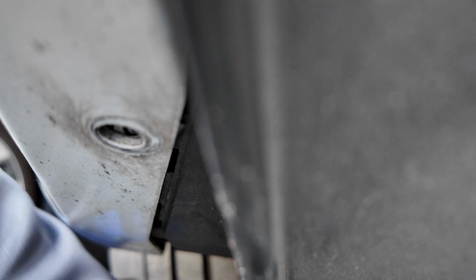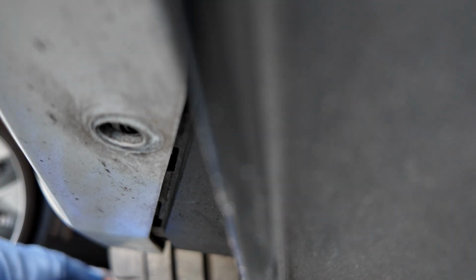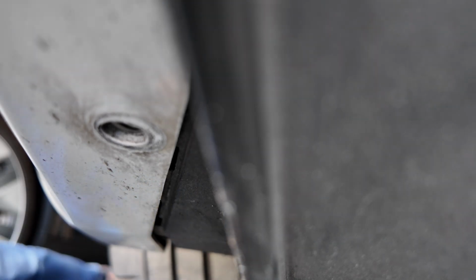I'm gonna pull back this body panel so you can see here's the clip, and it's kind of got moved over, it wiggled around in the wrong place. So what we could do is just get something, slide it along back to where it needs to go, a little higher, and then push the panel back over and then find the slot for the clip, and then line it up like that. In this case with a screwdriver.